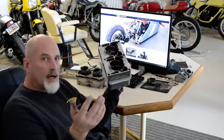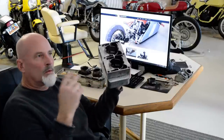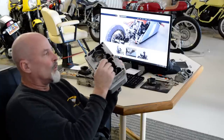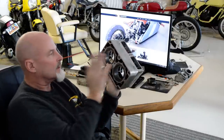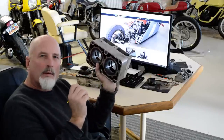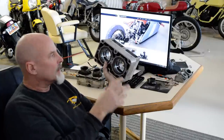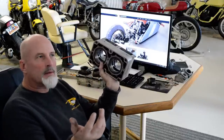Going back to land speed racing, you only have a really tiny window, and if something goes wrong during that time you're screwed until the next year. So the thought process was to do this thin liner — it would retain less heat because you don't have this big massive liner. And it's almost a press fit; it's not an actual hand fit. But I think with a rubber mallet out on the salt in an emergency, if I needed to replace a liner, I could get away with it. I'm not sure how close the bore would be after pulling one out and putting it back in.